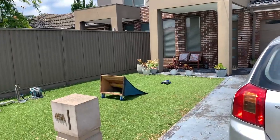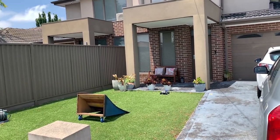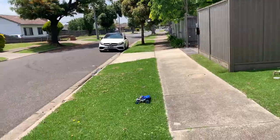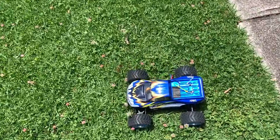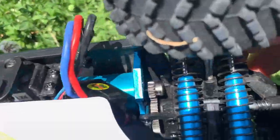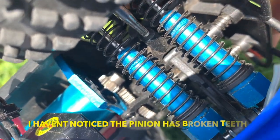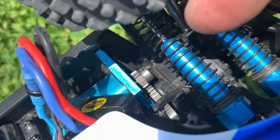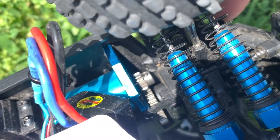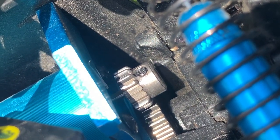Let's try that again. Something's let go — uh oh. I reckon I've lost the pinion. The motor's shifted off the spur gear. With all the jumping and bashing, it's decided just to shift, which stripped a gear. They are metal on metal, so I will inspect this. I've broken teeth right there on the pinion. What a bugger. That's it guys, that is it for me.